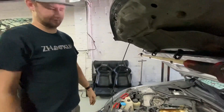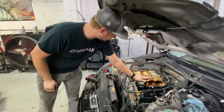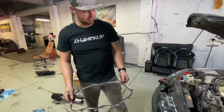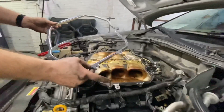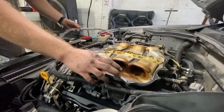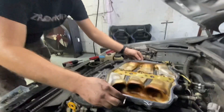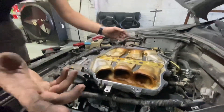Through the magic of editing, we got the spark plugs replaced and new valve covers on here. We went ahead and put this other part of the intake on — this is all torqued down again. Now comes the second half of the plenum install. With the Z1 kit, we have this plenum spacer and the gasket that they include. To line it up here, they're just cut out right here for this stud, and then another one over here. Normally we'd go ahead and put a new gasket on, but this one's looking pretty alright so we're not too worried about that. Put this on and line it up. If you want to put a little silicone on here you can — everything's looking clean here, so I'm not really too worried about it, but if it's something you want to do, that'll go ahead and seal it as well.